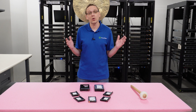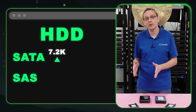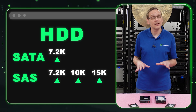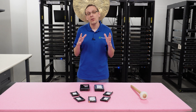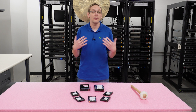So what speeds do you get with those choices? For a SATA hard drive, you get 7.2k RPM — that's what you're going to get. With a SAS hard drive it's going to be a little bit faster; you can get 7.2k, 10k, or up to 15k. I will note, especially since this is an older system, that a used 15k SAS drive — going around 15,000 times a minute — the ball bearings are going to wear out over time, so I would keep a spare in stock because they are known and prevalent to fail.